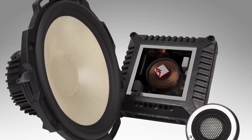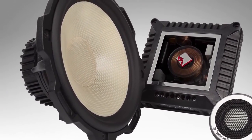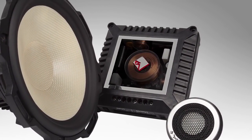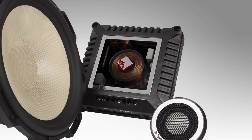The T3s feature a 1-inch treated silk surround LCP — liquid crystal polymer — tweeter with a neodymium motor structure. They use a liquid crystal polymer fiber cone mid-range that is very lightweight and very durable, a true Nomex spider, an asymmetrical crossover network, a die-cast aluminum frame basket on the mid-range, and a neodymium motor structure with key-return magnetic flux lines assembly — which maximizes the return magnetic lines through the motor structure to maximize efficiency and reduce overall distortion. It's all about sound quality and that audiophile aspect.